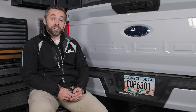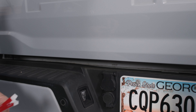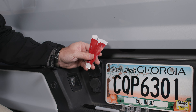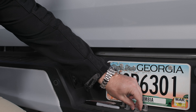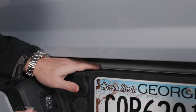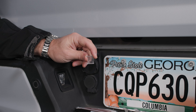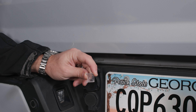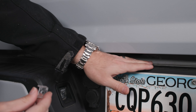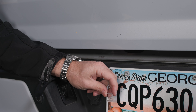The first thing we're going to want to do is mount our tailgate bar directly under our tailgate. We've got two options. The kit includes 3M adhesive backing strips that you can use, but what we're going to be using today is our custom brackets. These are going to mount directly to our tailgate underneath it, and then the bar will mount directly to these brackets, giving a stronger, more permanent installation. These brackets are also great when working over any existing elements underneath the tailgate.